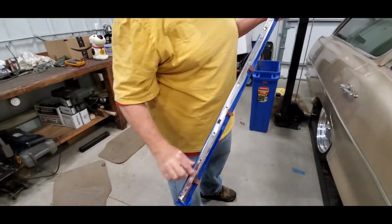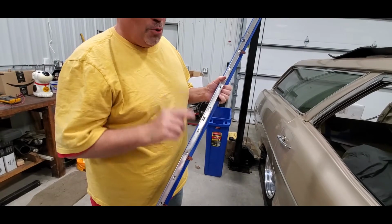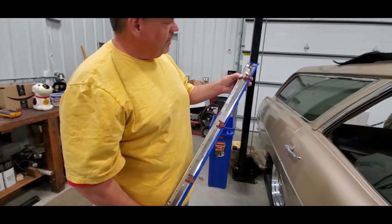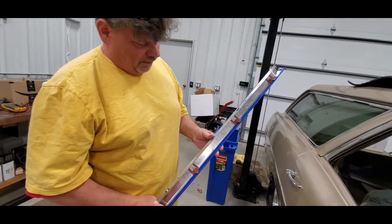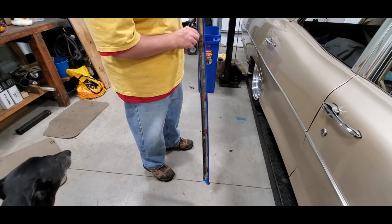And they have an adhesive piece that'll fit right across here. We're going to order that up. With no chrome bead, so it should fit. So we'll try that. I'll order that up and try to get this in next weekend. And what did you think of using the hammer and dolly to clean that up instead of bending it with your fingers? Look how straight that is. That is so nice and straight.